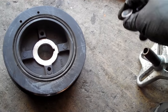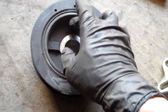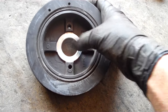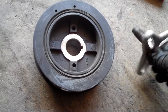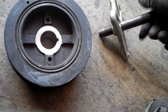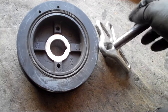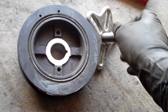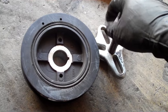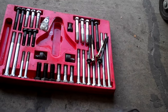You can see I used the flat part. When you look at the balancer, it just has the two bolt holes. You can see they were going to do them a little further apart but opted to go in — and there are even casting marks showing an option for four holes. It's not super hard, but if you don't know this it can be really frustrating. These bolt pullers are not very expensive; you can outfit them with whatever bolts you want. You can see I've added a few that are M6 by 1.